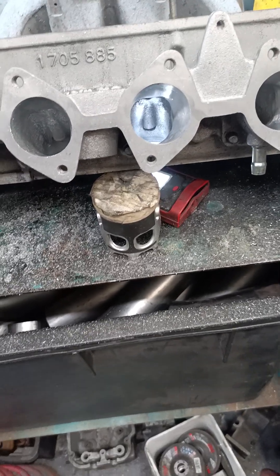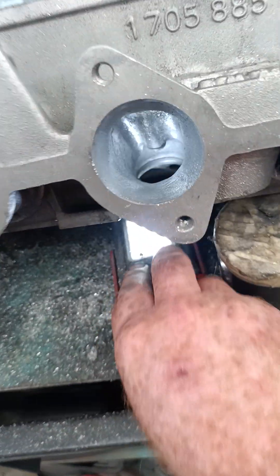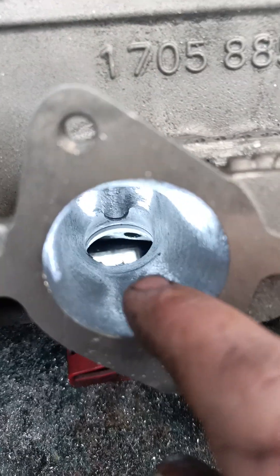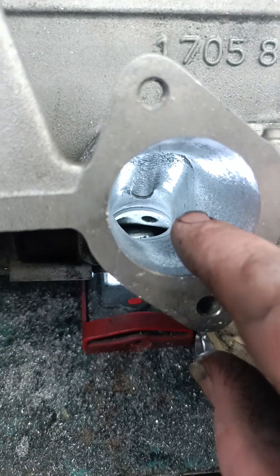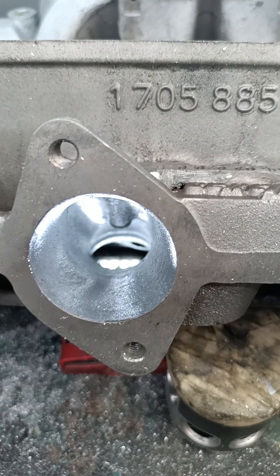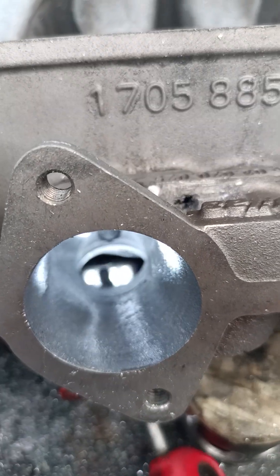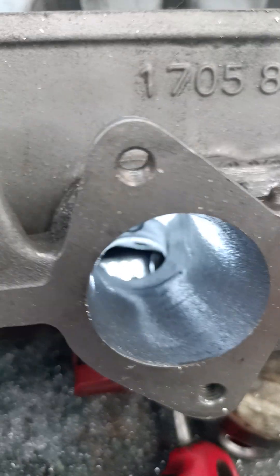Just remember — don't take too much. At the start, all you're looking at is a nice clean up. You're just looking to smooth over bumps and get the match half decent so there's no edges for your air to actually hit on. You can decrease guide bosses and do a little bit of a bowl blend. Your real gains on most cylinder heads are around the short turn. Now these are a little bit different — they've got a real shallow short turn, so with a shallow short turn you aim it a little bit different.